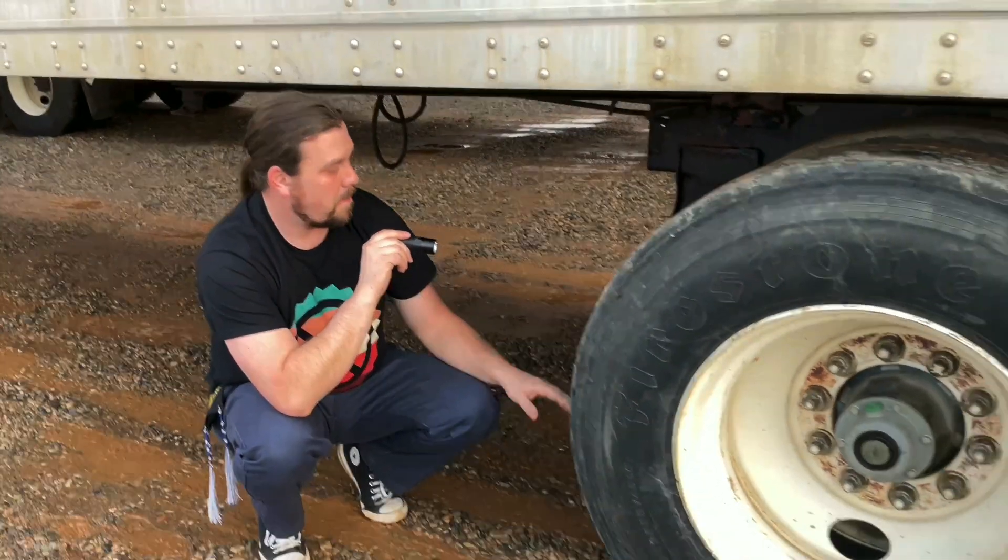There are no rusty streaks indicating loose lug nuts. My lug nuts are securely tightened. My rims inside and out have no cracks, bends, or repair welds, and my hub oil seal is not leaking. I would examine my rear trailer axle in the same way as the front. My splash guards are securely mounted and not damaged. If this trailer had ABS, the ABS light would be present at the bottom of the trailer.